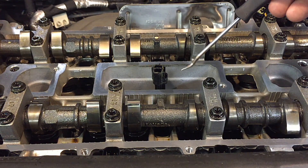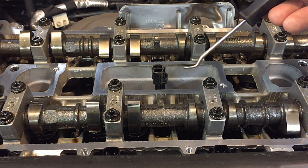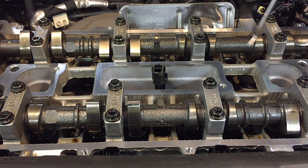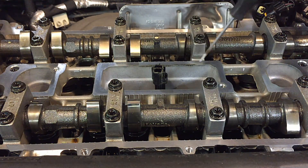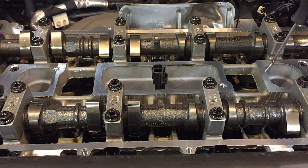This applies to four-cylinder, six-cylinder, and eight-cylinder engines — the heads are all set up this way. Now there's one basic design flaw with these, and it has to do with the valve cover gasket. The gasket seals around the outside of the valve cover, but it also has to seal around the ports, because down in here is the spark plug — that's a dry well.